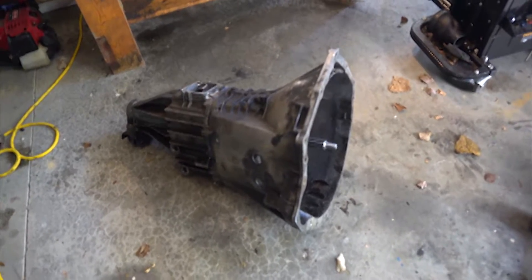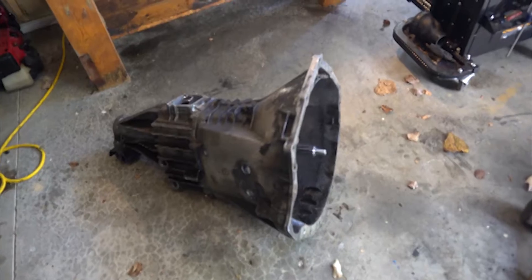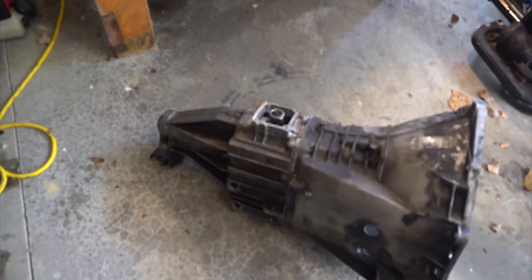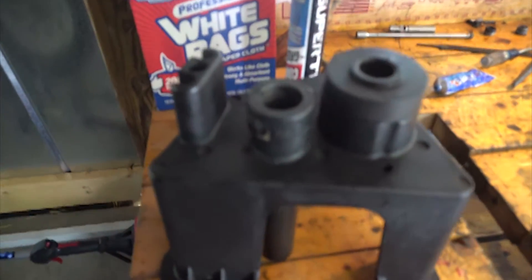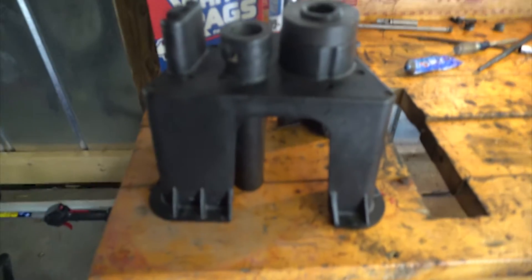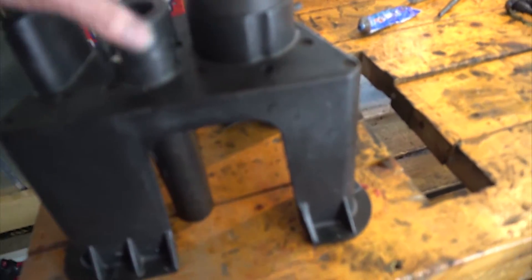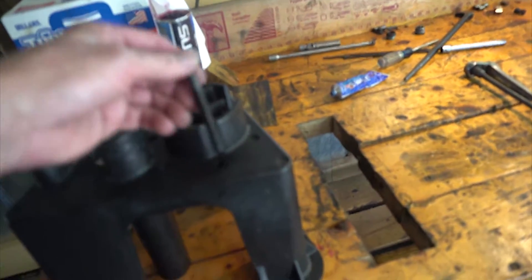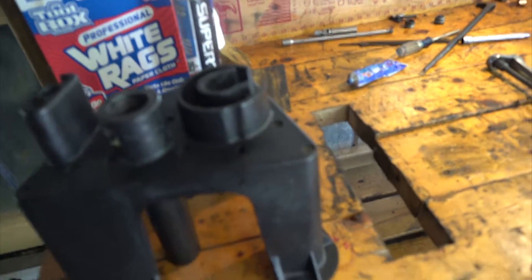This is the final update on this NV 3500 transmission repair. You could make your own jig to hold all of the gears together in the tail shaft housing during disassembly, but I would recommend getting the right one. I can put the part numbers in the description below. It comes with spacers for the correct transmission — for some reason this one was not correct, it was too thick, but it worked anyway. This bearing retainer guide — you screw it into your bearing retainer, and when you slide the tail shaft over it, it comes out of one of the holes. Then you pull it back, put your bearing retainer bolts on, and remove it. It's worth getting one of these.